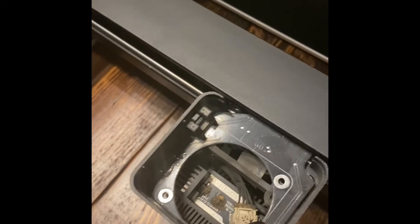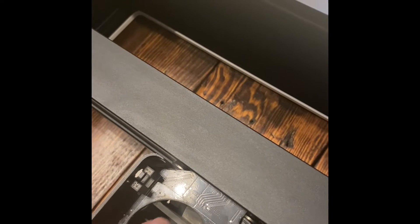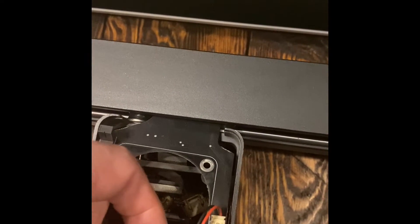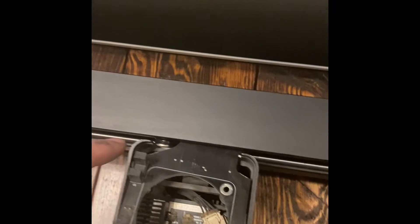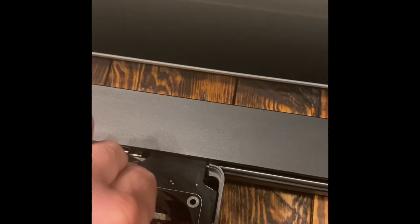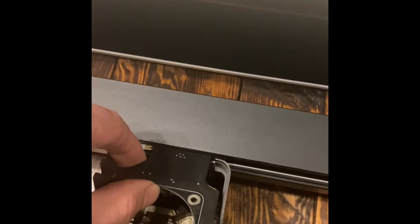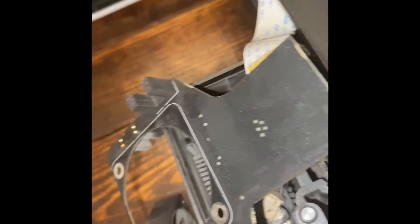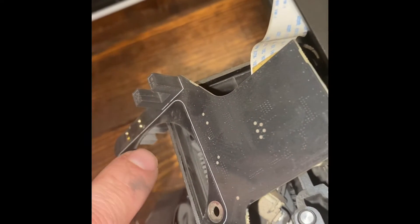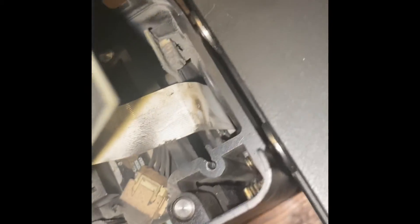On this sensor board, typically what causes the most issues is that you have this sensor and then you have a sensor on the bottom. Typically this sensor doesn't get as dirty as the one on the bottom, and that's the one that actually causes this issue the most. Take the sensor board and pull up this way — be very careful. There's a ribbon wire here and a ribbon wire on the backside. You have to gently pull this out because you don't want to damage that ribbon wire. Keep lifting up and gently start pulling and it will come out, but do not force it. That's the second sensor I was talking about — you can see how much more dirty it is compared to this one. That's the one that usually causes this issue the most. And if you look down in here, you can see how much debris gets built up.